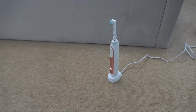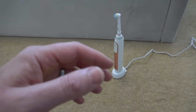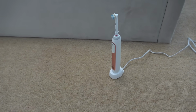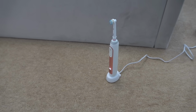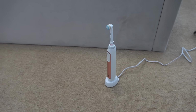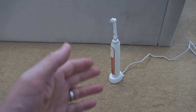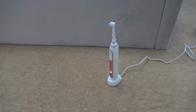So am I right in thinking in this instance, bigger is better? Surely if something's bigger, it can dissipate the heat quicker and it's going to be less likely to be under so much stress. So could that be now better than factory? Be interesting, wouldn't it, if it would be better than factory? But please don't blindly follow me. I put a 1.1 amp fuse in. I went for less rather than more because I'm thinking if it fails, I can then go over to the 2 amp one. I've got a 2 amp one in the exact same size, so hopefully I'll be able to use the same wires and everything like that.